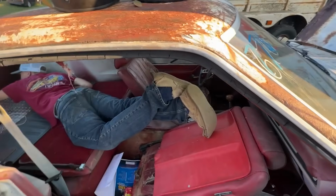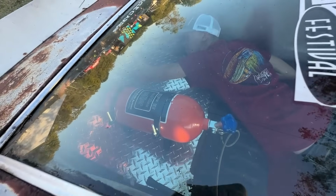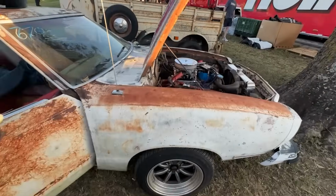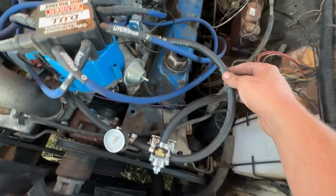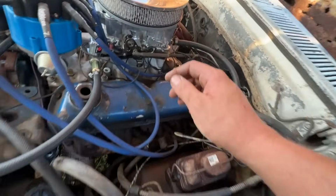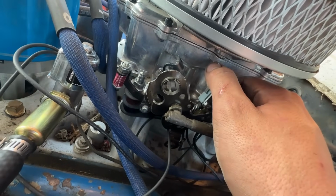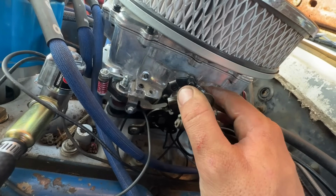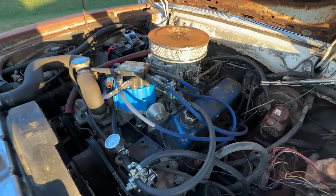Well, we're done with the autocrossing, and Briar is buttoning up the last of our install for that beautiful nitrous bottle. The Sniper Nitrous is gonna be good. So what I've done is I plumbed in a T-fitting with a pressure gauge, and then this goes to our fuel solenoid. So it's got a trigger switch, an arming switch inside the car, and then a wide open throttle switch right here. Whenever I push this, you can hear them click. So they're armed. Whenever it's matted, it'll go all the way to that switch. All right, Briar, we're gonna check for leaks real quick. So open her up.